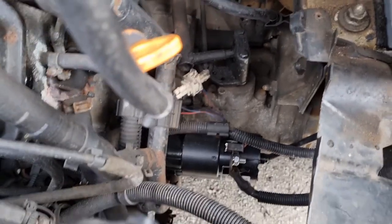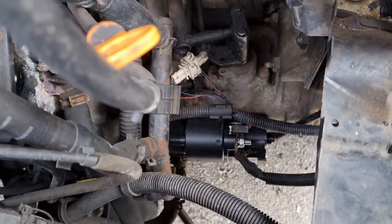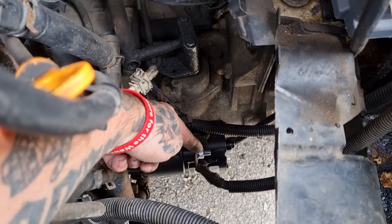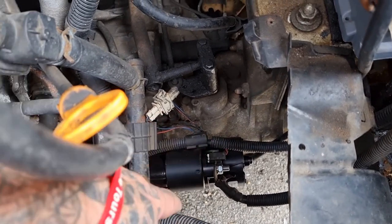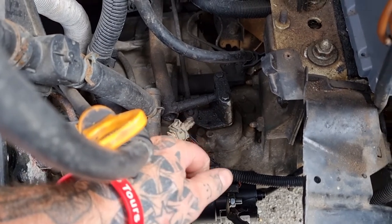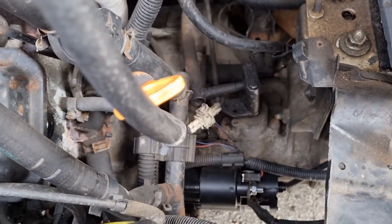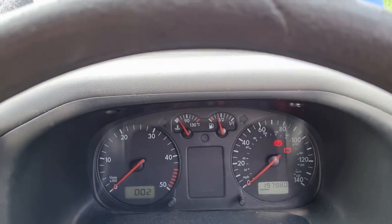I've put the bottom two bolts in and the top bolt is tucked in behind the wires. I've done the cable on the spade and done the power nut up — don't over-tighten this nut; it came with a split washer so it won't back off on its own. The tip I can give you: when you put the three bolts in, don't do the bottom ones up first — put them all in hand-tight just to make sure all the holes are lined up before you tighten them right in. Battery is back on, so we'll give it a fire up now. It's out of gear — here we go.